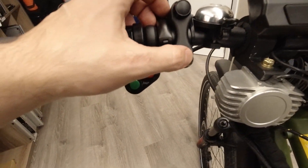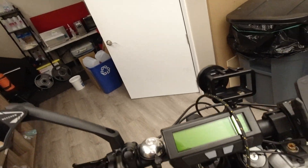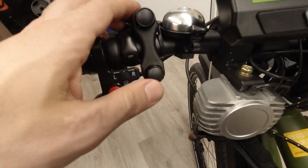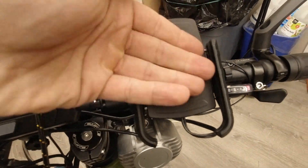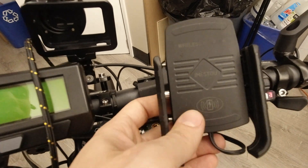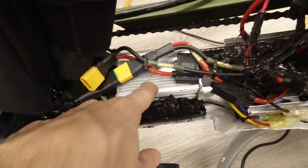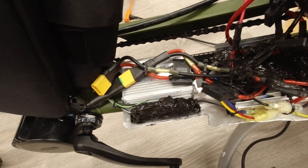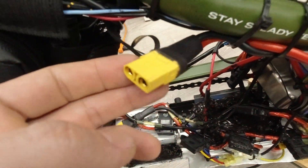This is for the charger — if it's raining, I'm not going to have my USB-C cables get corroded from having voltage going through them. That's for the phone chargers. This is a wireless charger and phone holder, so if you have a phone that wirelessly charges, you can put it in there. This DC-to-DC is also fused on the input, so if this thing shorts, it doesn't kill any of my system — in addition to all the batteries having their own fuses, that has a fuse, and so does the charging port.